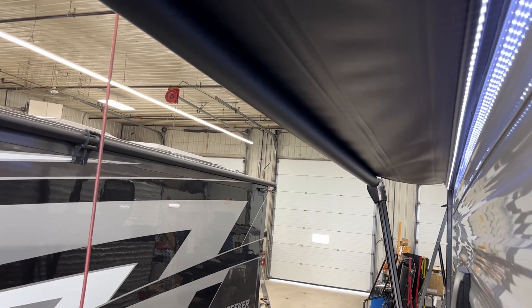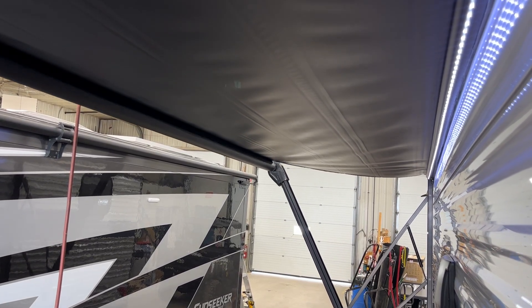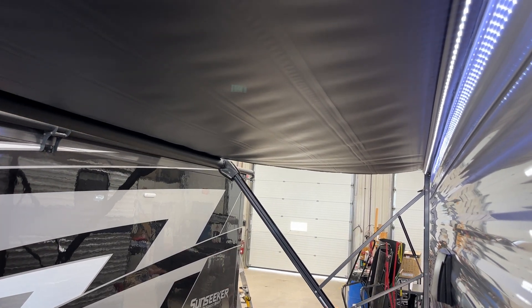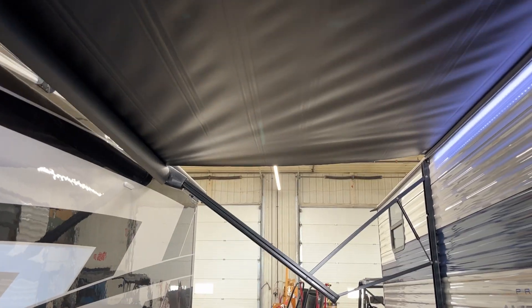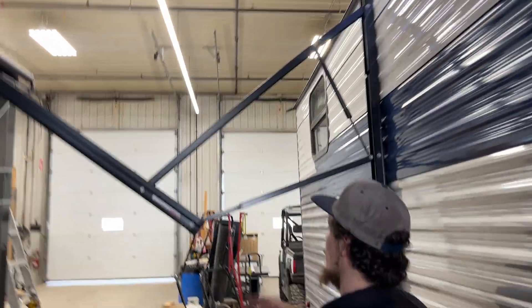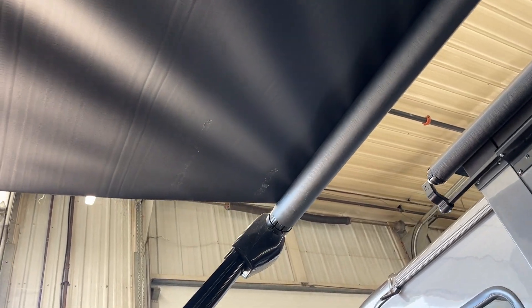Once the awning is fully extended, you're going to see a little black flap come down as well as the black of the metal tube — once you see that, stop. If you continue extending, it can wind itself up backwards, with the fabric underneath the tube, allowing it to hold water and accelerating mold and mildew growth. If it starts raining, you can grab the front or rear arm and pull straight down to change the pitch of the awning, allowing water to run off. Before bringing it back in, make sure the arms are back out straight and fully extended so you're not risking bending them. Then press and hold retract and the awning will make its way back in — watch to make sure the fabric stays over top of the tube. Keep in mind the awning catches a lot of wind, so once you get up to about 15–20 km/h, bring it back in.